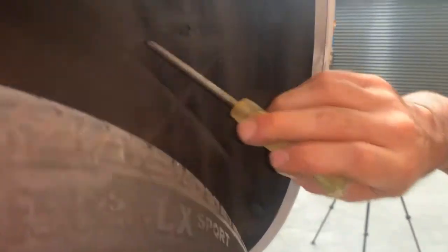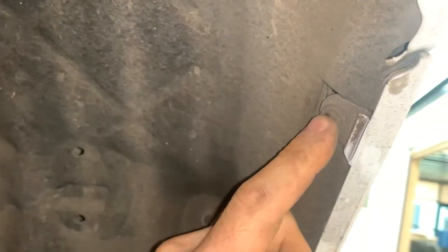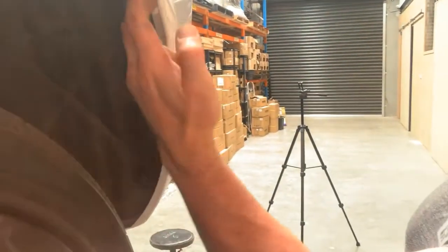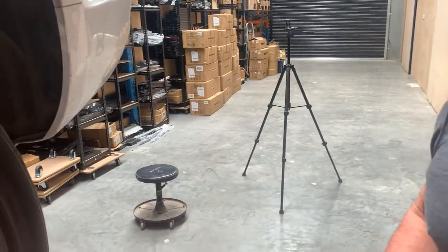We'll just locate and take this one out. You can see it's starting to come off. We've got a plastic lug that we need to pop off here, and another one up here. Just work your way around taking them all out. You can feel that the actual bumper is loose. Just be careful — get someone to help you. When the time comes, maybe leave one of the screws in lightly on each side and get someone to help you.